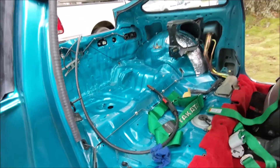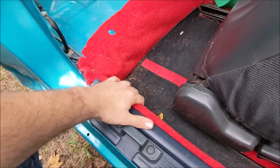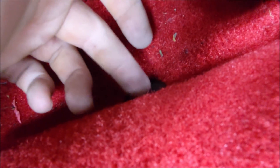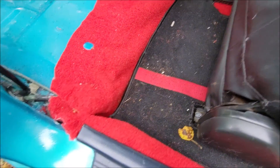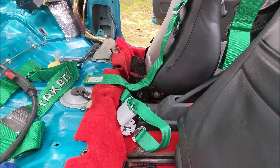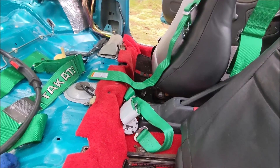The bar does have arms that come down from where the bar goes and go down to where the bottom of the seat belt mounts on pillar mounted seat belts. Luckily on the passenger side there is a little plastic screw right here that goes into the hole where the seat belt would mount on this side, but there's just no seat belt there. There's not the same thing on the driver's side though, so I'm going to have to pull the carpet and see if there is one, and if not I'll have to weld another nut on that side.